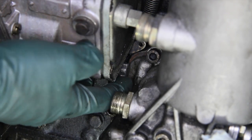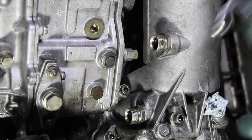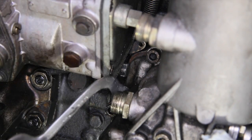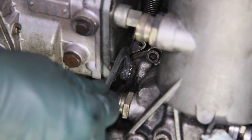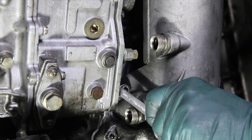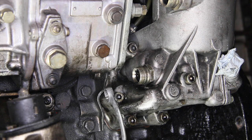Getting on this bolt and loosening and tightening it is about as difficult as filming it — it's almost impossible to even see in a video scene. On this engine you would have two oil cooler lines coming out, so trying to get a regular wrench in there and getting on the back of that nut — you can hardly see it, it's near impossible. But with this wrench, choosing this particular angle, I can go right between the oil cooler hoses and get on that bolt. If it doesn't catch there I can lift it up, get right on it, and loosen it up. All you have to do is loosen that bolt to adjust the pump — you don't have to take it all the way out. If you're having a problem getting in between the oil cooler hoses, you can flip the wrench over and go underneath right here.